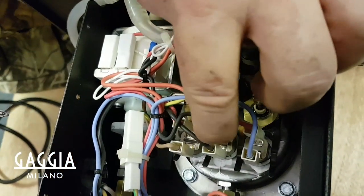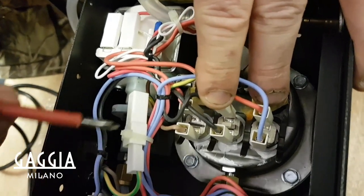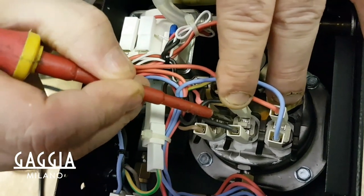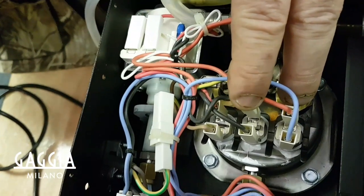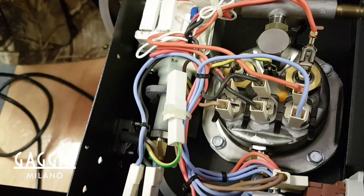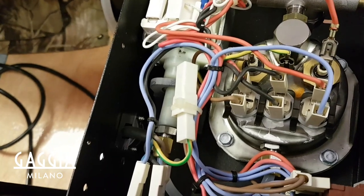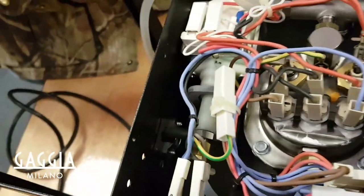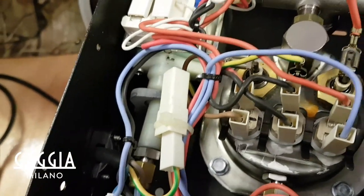You might not be able to reach this with your finger. If the machine is unplugged, it doesn't really matter — you can press it with a screwdriver or a skewer or something like that. So there's your little button in the middle. When you press it in, if you hear a clicking noise, you know that was the issue and the thermostat just tripped. If it doesn't click, then it's a different issue. It's a very, very slight click noise so you may not hear it, but if you have pressed it, it seems to do the job.